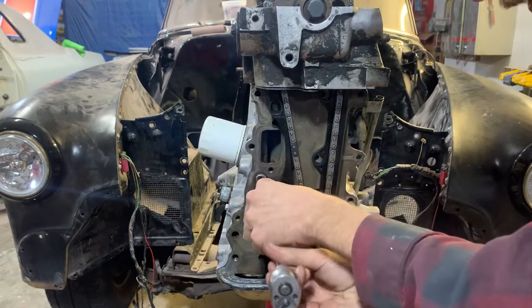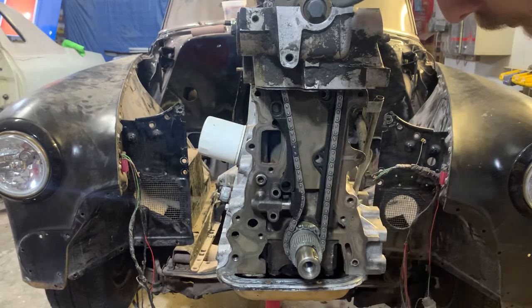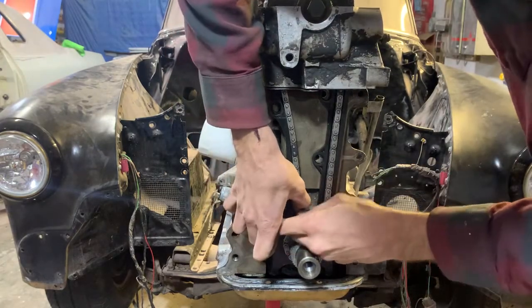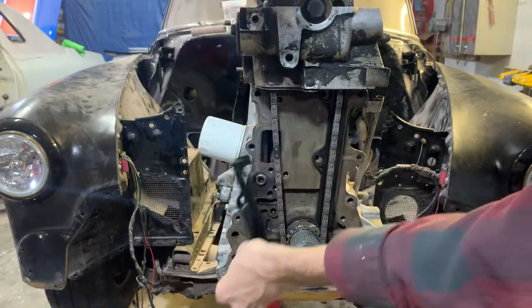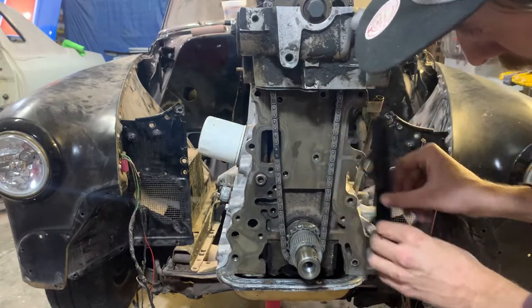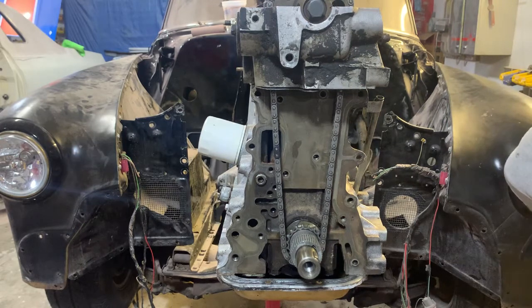When you replace your timing chain, it is suggested that you replace your sliders. I believe it's Evergreen or some company like that that sells metal ones. That's what I've got in my other truck. They're freaking nice, and they keep the chain pretty snug, and they've got like a rubber or plastic face on them where the chain meets it. I think it was like $40 for the entire gear and chain set with the sliders. I haven't had any problems out of it.